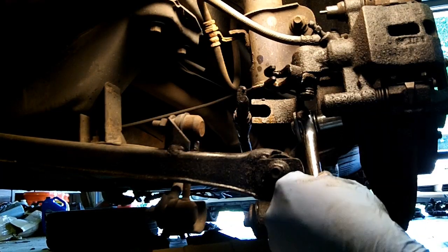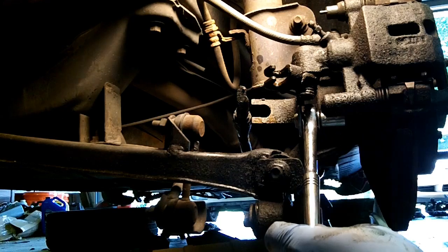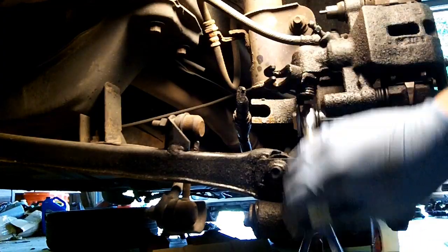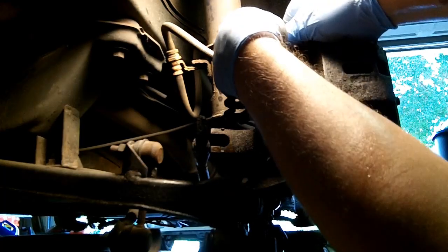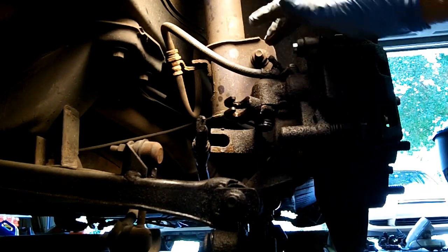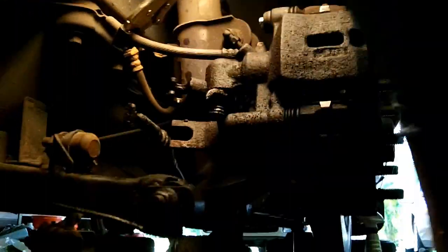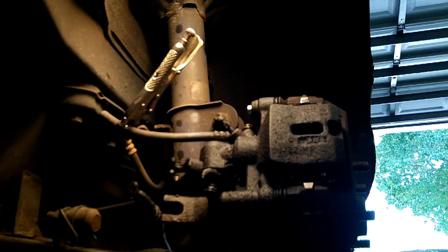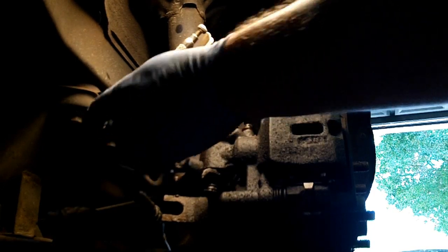Now we have a 14 millimeter bolt here and I've only got a 3/8 inch ratchet. This other side should have a cap on it — cap's in good shape, don't lose that. Before I remove the top one, I want to go ahead and get my brake line off. We're going to take our vice grips and clamp off that line. Didn't take much to crack that loose. If anything spills out, I'll just catch it with some rags. Expect this line to be clipped off — if it's not, it's going to make a big mess.